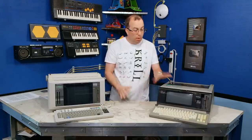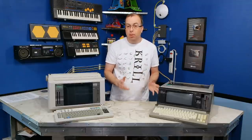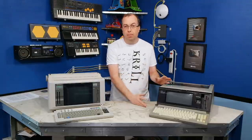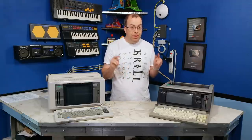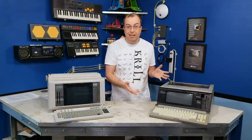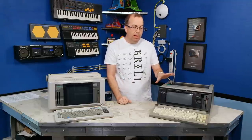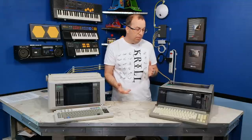This Brother unit is actually pretty cool because, if one had the time to spare, it would actually be a pretty cool hacking project. Since it has a Z80-compatible processor and a lot of well-documented off-the-shelf hardware, you could in theory remove the word processing software ROMs and replace them with some sort of BASIC or even some games. Now granted, I doubt that the video chip supports any sort of bitmap graphics, but I'm sure you could do Commodore PET-style graphics or something like that on there.